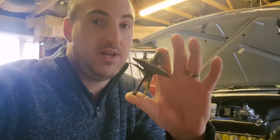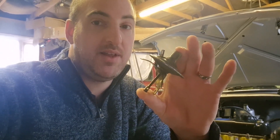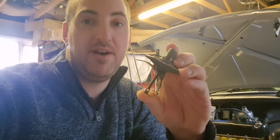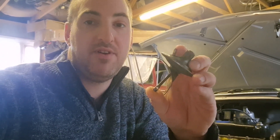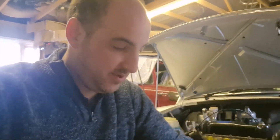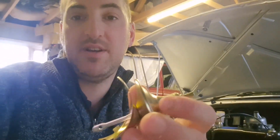This one — the diaphragm inside, I think, is gone. Inside this bell there's a rubber diaphragm; when you suck on here it pulls the diaphragm up, which is attached to this arm. If you suck on there, nothing happens. Here's a new one — this is a Mini Spares one — and if I suck on the end of this, hopefully you'll see that arm move.